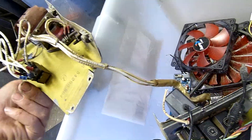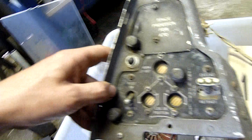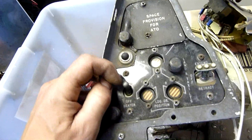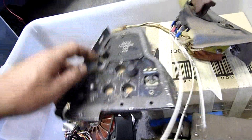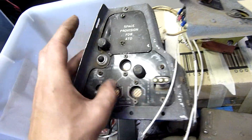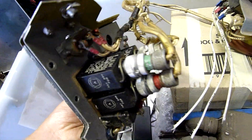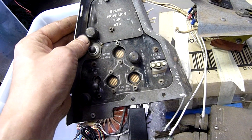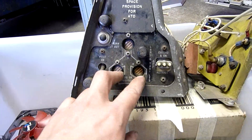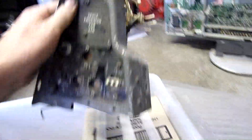Wow, look at the old cloth-wrapped wiring — hand-tied, wax-coated. That's awesome. What is that? Provision for ATO — pilot heater on/off, extend and retract landing gear, land, taxi, and LTS. These things here seem to move — they're visual readouts of some description. Landing gear position indicator — they're not just lamps; they're actual indicators that probably take a reading from an encoder telling the position of where each part of the landing gear is. If one of these stays red and the other two are green, it means you've probably had a malfunction on that piece of landing gear.